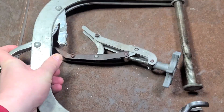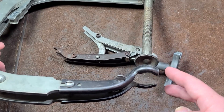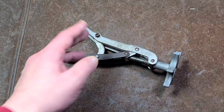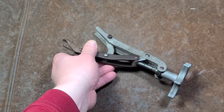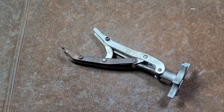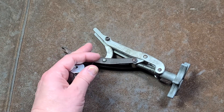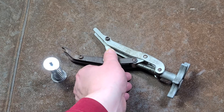It's something that could potentially be used while the cylinder head is still on the engine, versus one of these giant monstrous atrocities — a valve spring compressor for when the cylinder head is off the engine. This actually wraps around the whole cylinder head; the valve sits there and then this presses down on the spring. You adjust the length and then it has a quick release type action. Technically you're supposed to use these when the cylinder heads are off the engine. You're using these to attempt to replace valve stem seals — those are the little seals that go around the end of the valve to prevent oil from leaking into the engine, causing bad smoking. Seems like a lot more modern cars don't have that issue anywhere near as much as older cars, unless maybe it's a Chrysler product.